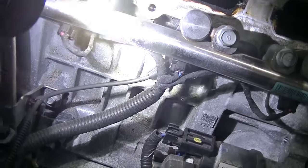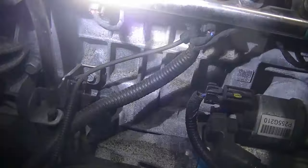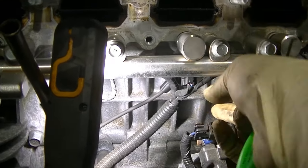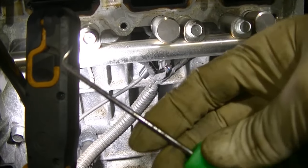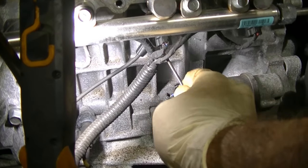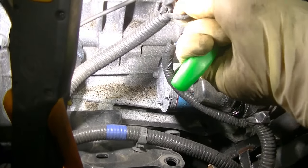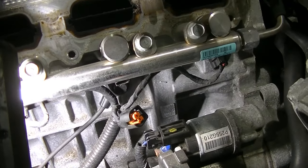You can see the knock sensor right there behind that clip. We're going to have to unplug that injector and then remove the knock sensor. When we install the new one, it is very important that we use a torque wrench and torque it to exactly 15 foot-pounds. To gain access to the knock sensor, we have to unplug the number three fuel injector. There's a little clip behind it that we have to unclip — I'm going to use a little hook tool because you can't get it with your fingers. Get it behind here, pull down, and you'll feel it disengage, then you can unplug the injector. There we go — injector unplugged. Now we have access to the 12-millimeter bolt that secures the knock sensor.